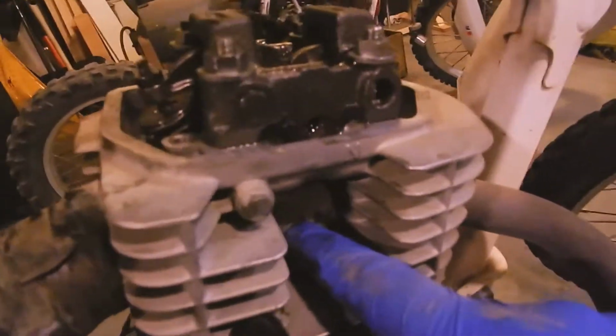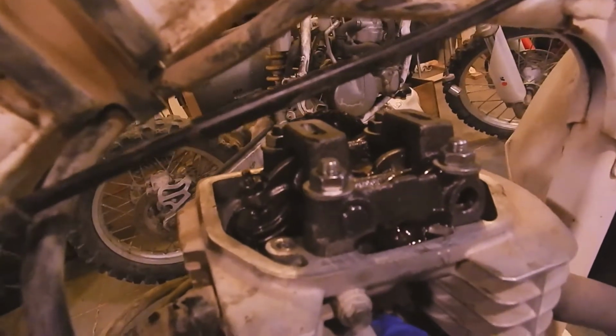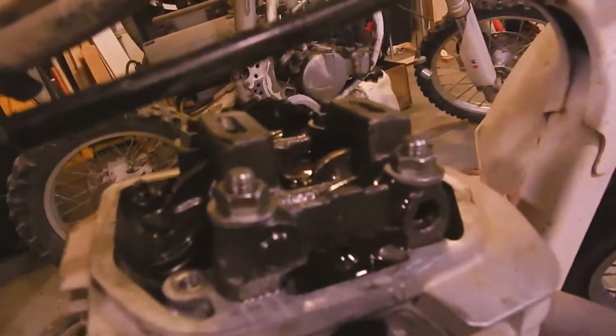I wonder... There was a nice puff again. It wouldn't be bad rings because now I'm getting it fairly consistent. You know, I don't know what's going on here. I really don't. Starting to get oil up into the top end. It had been sitting for so long, the oil had drained all out. So now, by turning it over, I actually can see oil start puddling out the end of the camshaft there.